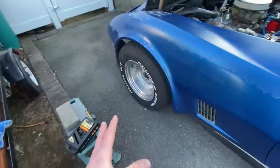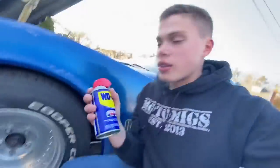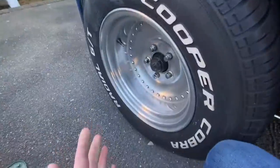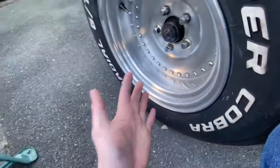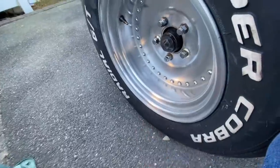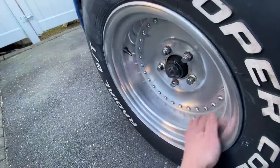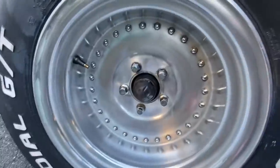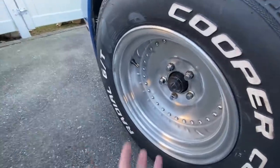Wow, that actually makes the car look so much different. You could definitely see the difference. I'm not one that's really great at detailing and cleaning stuff, but I am pretty stoked on that. The reason I bought the WD-40 is just to give it a coat when I'm done to help protect it from the environment, because WD displaces water. And when water sits on aluminum wheels, it gathers water spots and then it'll start corroding. Since we just scraped off that layer of disgustingness and it's now down to fresh clean metal, I'm going to go ahead and put on that extra layer of protection to help prevent us from doing this again like a month from now.